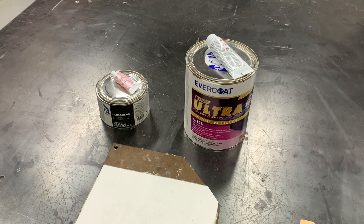So the discussion is: does polyester filler absorb moisture? The reason I ask that is because you're putting it over a stitch weld bead and it may not be uniform — you may overlap 50% of each of your spot welds, but there may be some thin areas above or below that weld where moisture can enter from the backside. If you can get to the rear and seam seal it, that's the best thing to do, but there are areas — for example the bedside on that truck — where you can't get to the rear, or if you're doing a repair on a rocker.